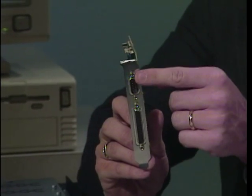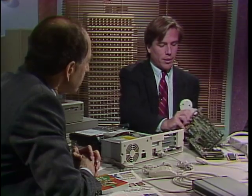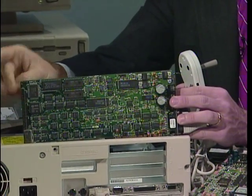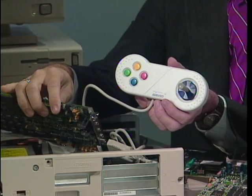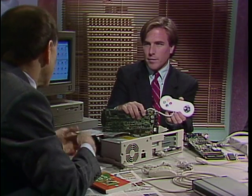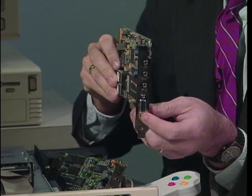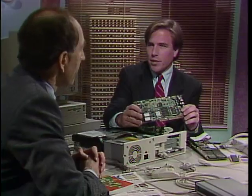For standard slot cards, if you need another parallel port or a serial port, this card gives you both. Some give you even more — so you tie up a slot but get more ports. Here's a soundboard — this is a sound card that also offers a CD-ROM interface. It's an 8-bit card, and it has a game port that lets you connect your joystick or game pad. But not all soundboards have a joystick port. This board has the CD-ROM interface, and it's also got a VGA port — it's actually a VGA expansion card doing Super VGA at 1024x768 — and it comes with a soundboard as well. So you've got to be careful when you buy a soundboard to make sure you're getting the right mix of components.